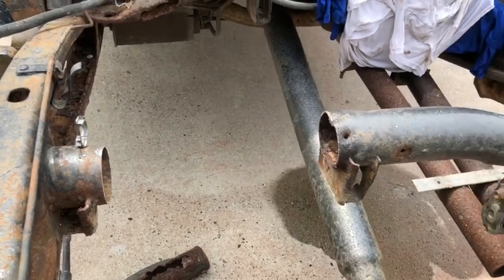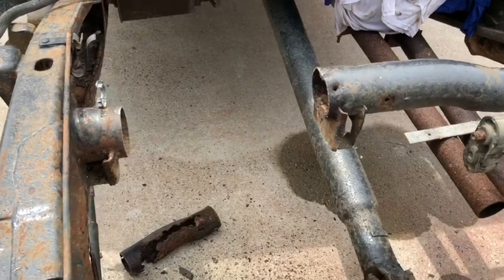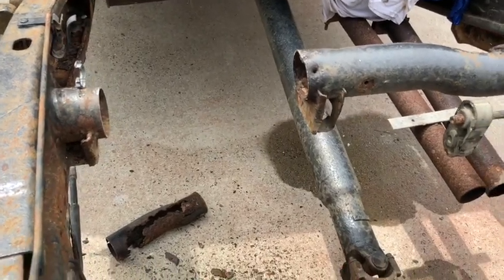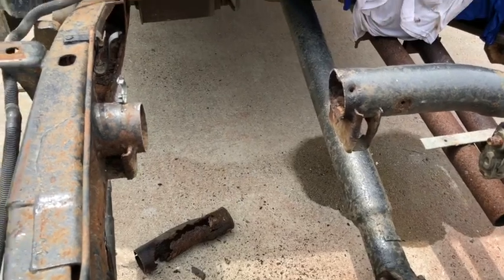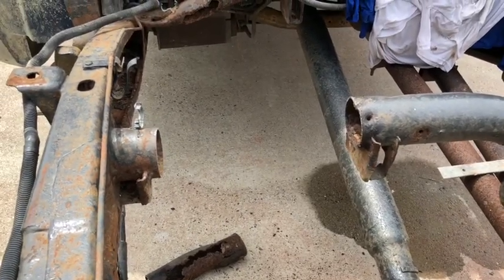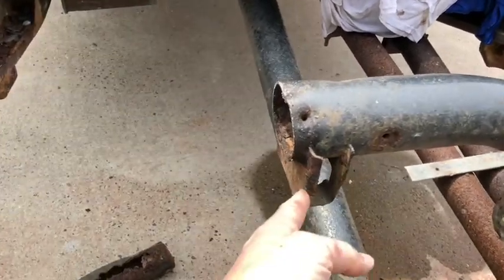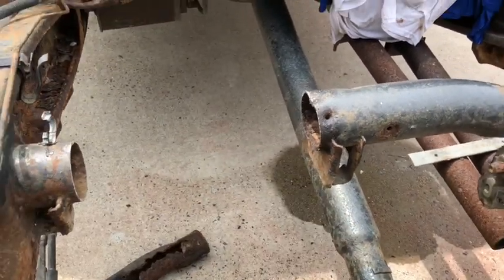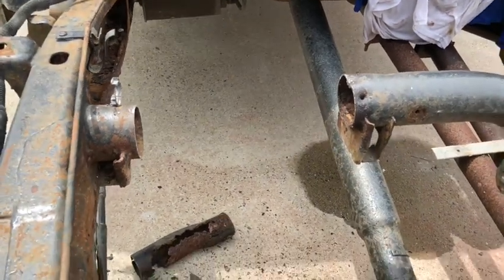You know what, this truck has a 2-inch lift. It's a very small lift, but you no longer really need that hump. You're not going to need it for clearance for the drive shaft. We don't need it for clearance for wires or anything like that. So I think we can just take that hump out at this point. We're going to have to rehang this bracket here, but I've got an idea on how to do that fairly easily, and I'll show that to you guys. So that's the update for now.